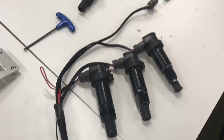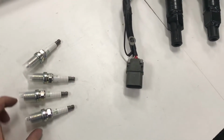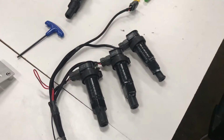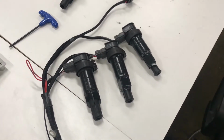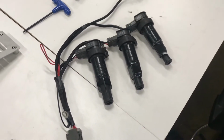And then lastly, you'll need to do your coil pack harness. So it's not nearly as hard as you think. I had to call a couple friends to ask them how to depin a harness, and I just learned it in the last minute and a half to do the first one. So I'll use that one to kind of explain how to do the rest of them, and then install and reinstall should be pretty easy.